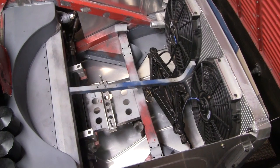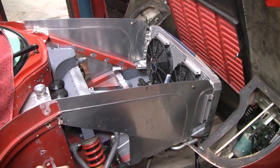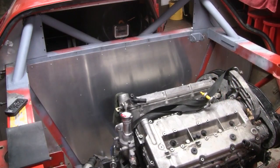Up the front we have a nice new aluminium floor plate which should help reduce the filth that enters the non-engine bay, and you can also see what I think is a fairly neat little location for the jack. I made a lightweight version of the bonnet restraint and because I'm all about symmetry I added one on the other side as well. I also made some pretty sweet-looking new side panels slash radiator mounts. Inside the cabin I finally got the aluminium to finish off the firewall on the inside, and out of the same gigantic sheet of aluminium I managed to make the outside firewall panel as well.